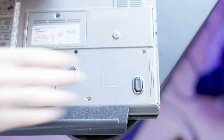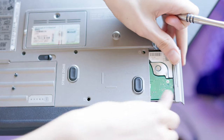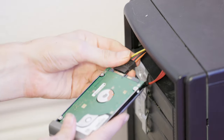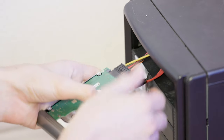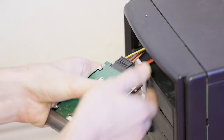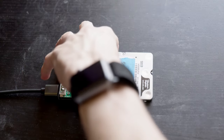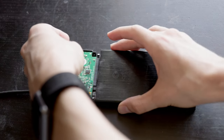In order to complete this method, you first need to remove the hard drive from the system — the same process used in the physical destruction method. The hard drive then has to be plugged into another system for wiping. I like to have an extra system just for this purpose, but if you have a normal desktop, there's often an extra SATA power and data cable inside. You can also use a USB enclosure and plug the drive into that, then plug it into a USB port on the computer.